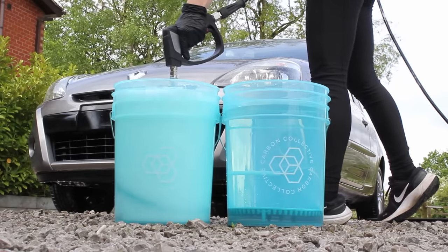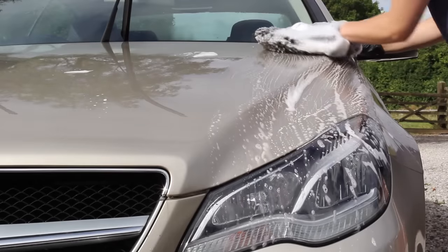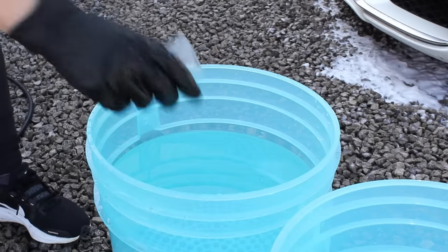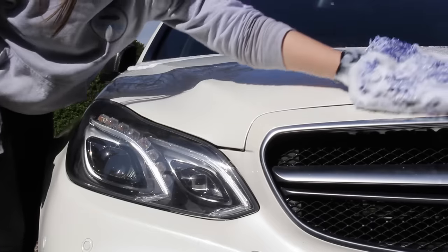Next up is using wax or gloss-infused shampoos. There is a caveat — these products suit a lot of people — but they don't work well with my routine. I find shampoos with waxes and gloss enhancers mixed in really clog up the existing protection already on the car. I used a coating on my MX-5 and then used a gloss-enhancing shampoo on my weekly wash, and found the coating just wasn't performing well because every week I was clogging it up. Even on unprotected cars, the gloss and protection left behind is very minimal. So I prefer using a pure shampoo that doesn't leave anything behind, allowing whatever wax, sealant, or coating I'm using to perform as well as possible.